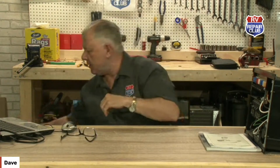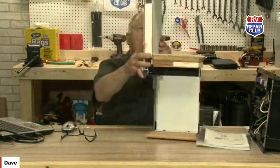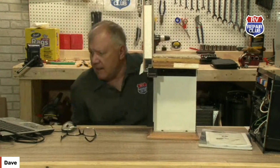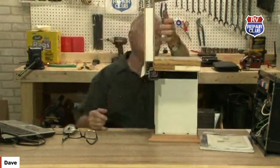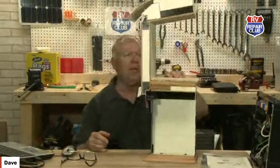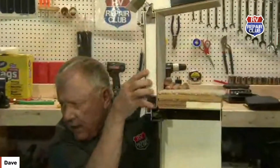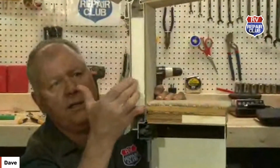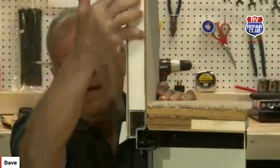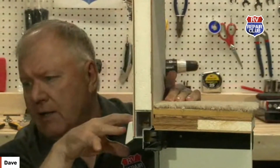That's very hard to say without actually seeing it and figuring out what kind of damage it did to the interior. Here is what your back wall is going to look like. This is about the same as the side wall. You will have an interior paneling, which is called Luan. After that, you will probably have block foam insulation. I don't know with your Travelmaster, you'll either have block foam like this, or you will have loose fill like you would see in a residential style.